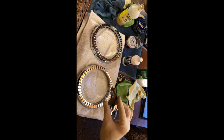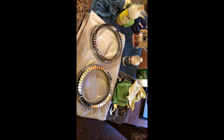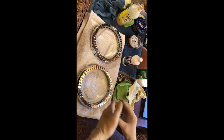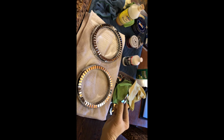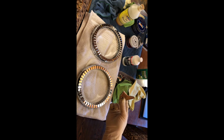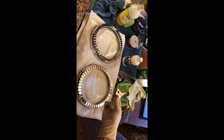Perfectly clean. Now, just to double emphasize, I'm not using the mag and aluminum polish on the chrome. It's really just for the stainless steel to polish that. The final step on the die-cast chrome-plated parts is just Noxon. And it's your option as well to use regular carnauba wax to protect these. But I do find the Noxon gives enough protection, and it leaves a brighter finish. Sometimes wax will actually make a very light bluish or dullish coat on the chrome because it's laying over it, where the Noxon is designed to be a metal polish, so the result is just perfect.